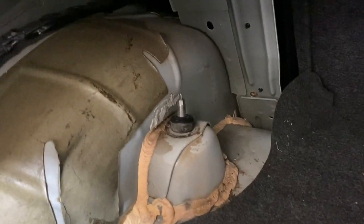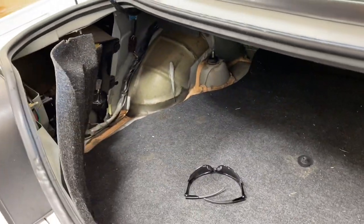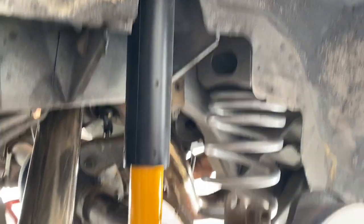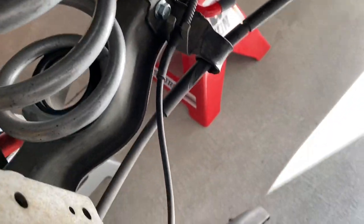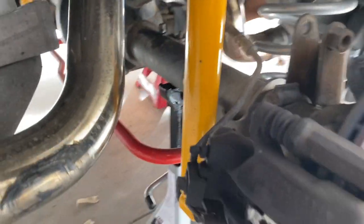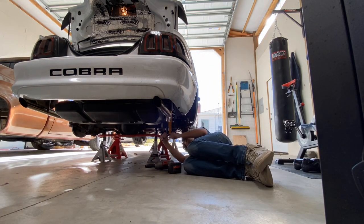Now go ahead and remove the rear wheels. Undo each of the nuts at the top of your rear shocks so you can eventually take the shocks out. You're going to have to take the trunk padding out on each side — I cracked mine in the process, so take your time, there are some clips that hold it. Your rear end is still supported on the jack stands — do not touch those. Just put a jack under the lower control arm, come up and touch it without putting any force, then undo the lower bolt and the shock will fall out. Repeat on the other side. The instructions are very specific: do not lower the rear end with the shocks out or you will damage the brake lines — and they mean the brake lines and parking brake cable back there. You will break them if you drop the rear end.